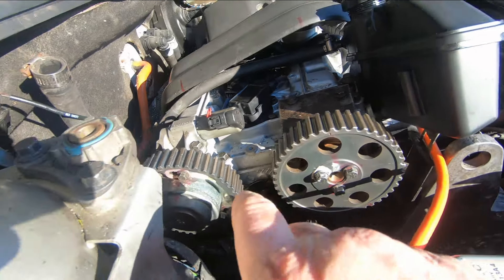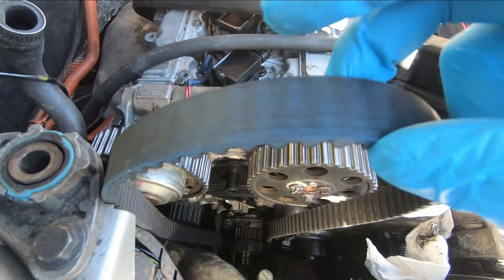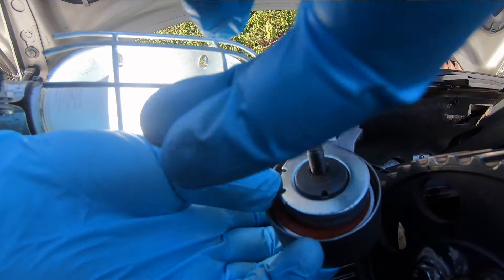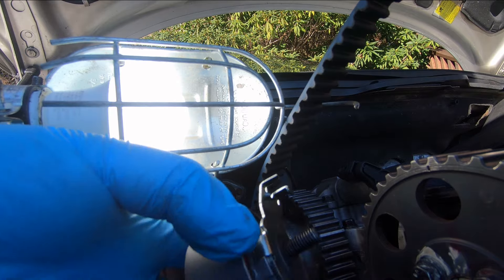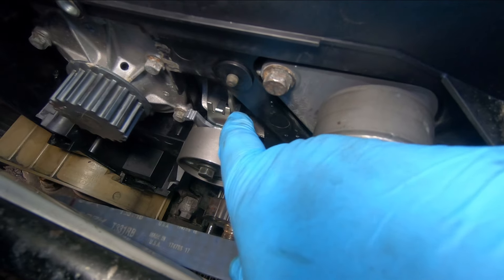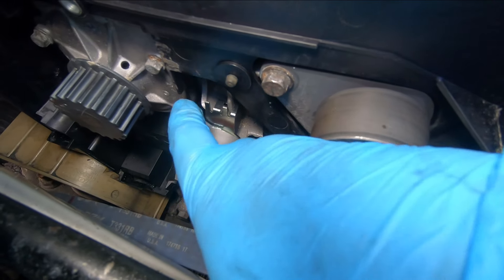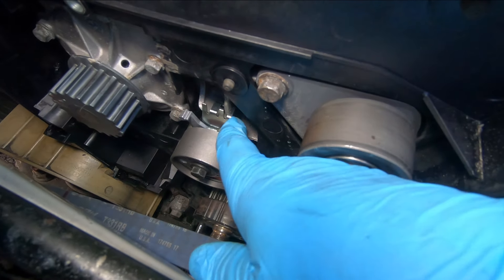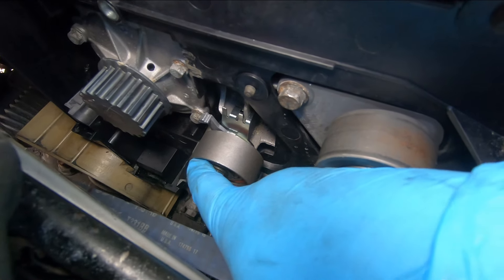I'm reusing the same belt — it's only six months old. You can see the bolt is eccentric, sitting pretty much at the top of the bracket. That's how you want it when you put it on the engine — the bolt's not tight yet. You can see how that little bent piece of metal straddles the web on the engine; that's where it's supposed to be. It's sort of a locator that holds it upright. The indicator hasn't moved yet because we haven't turned it with the Allen wrench.